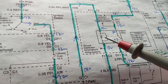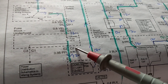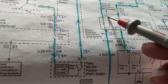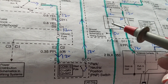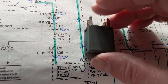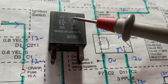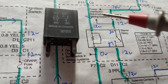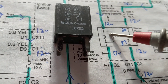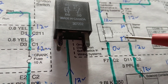With a good 12-volt battery, we have 12 volts on one side and zero on the other. We don't lose any voltage through wiring, through the park/neutral switch, through the fuses, or through the ignition switch. So it's 12 volts here and zero volts there — meaning we lose 12 volts across the relay. Is this part of the relay good? Notice: if you have an open in the circuit, terminal 87 — which should be closed — and terminal 30, which is always connected to 12 volts, will show 12 volts. Terminals 86 and 85 are the coil — you should measure some resistance if working properly.